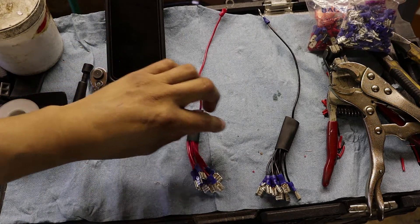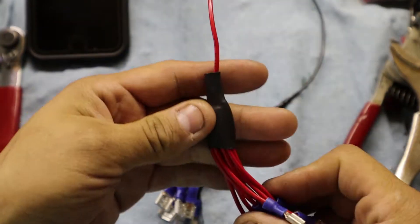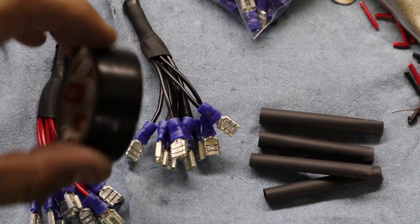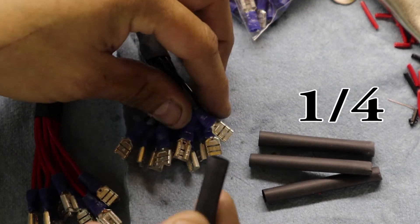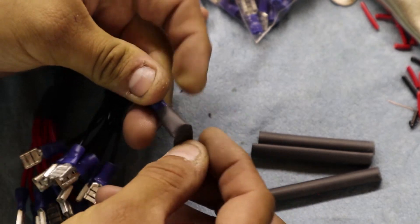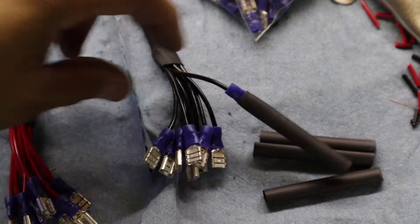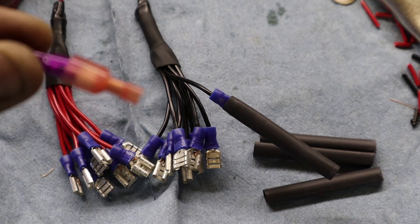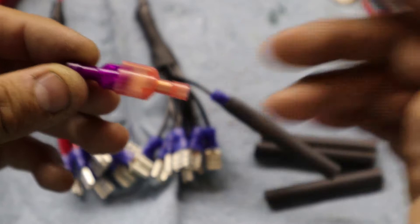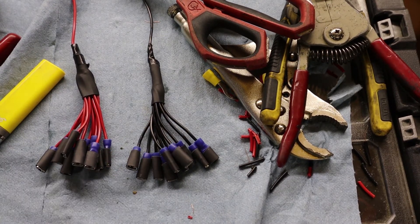Make sure it's a nice tight fit. After you heat-shrink the tubing, it may flare out a bit at the top — just get a little electrical tape and wrap the top to tidy it up. If you don't have heat shrink tubing, you can use electrical tape to cover all of the connectors. For the spade connector ends, use quarter-inch heat shrink — slide it over, fold it to know where to cut, cut right there, and heat it to isolate each spade connector. Do that for all of the connectors on the harness. As an alternative, you can use encased spade connectors — nothing wrong with that, though it does create more bulk. Now that all the heat shrink is done, let's go over to the bike and start connecting everything.